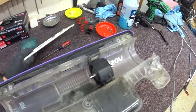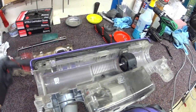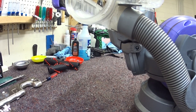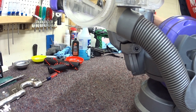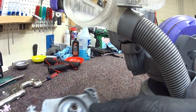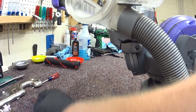Another oddity with this machine is it has a metal base plate. It's the only Dyson, to my knowledge, that has a metal base plate — some sort of low-grade stainless steel. Your brush roller is pretty aggressive, so it cleaned all right. It wasn't nothing to write home about, but it was on the level in terms of how it cleaned. In turning it upside down I've dropped out the little wheels, so I must find them and put them back before I return this to the customer. You also had end caps without a ball bearing — just a sleeve bearing. This is a newer brush roller, but the old ones were all one piece; they had to switch to a different plastic because they were getting chewed up. A lot of revisions went into that.